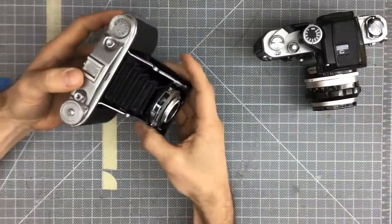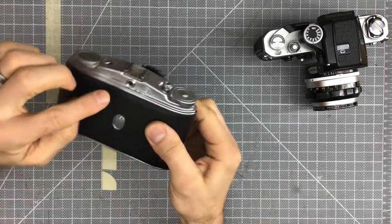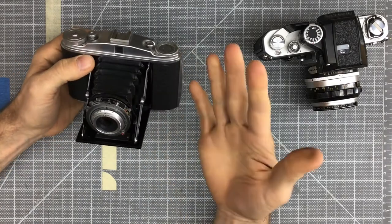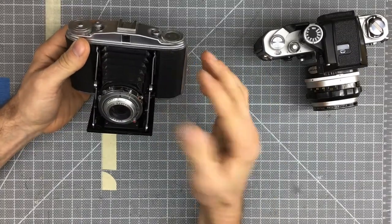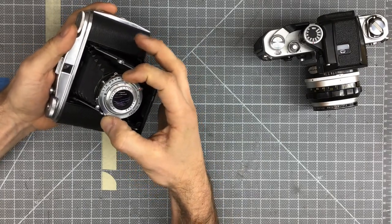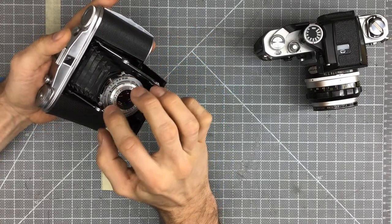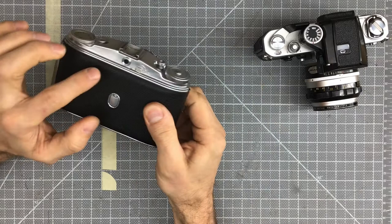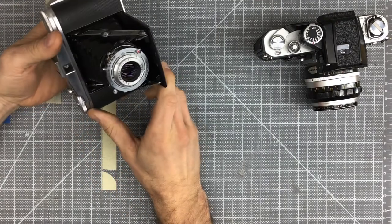But if you notice, it's got a lens up on the front, but really no way to bounce that image up. And so it has just a teeny tiny little eyepiece that comes through a lens on the front of the camera. And it was an approximate image, right? You kind of looked through the little eyepiece. It gave you a sense of roughly what you were taking a picture of. You had to be very careful to either estimate or measure the distance of your subject from the camera because your focus ring is set up by feet or meters. And so if you were off in estimating it, your picture was out of focus because this little eyepiece is just a teeny lens that's not connected at all to the actual image that's making the camera.